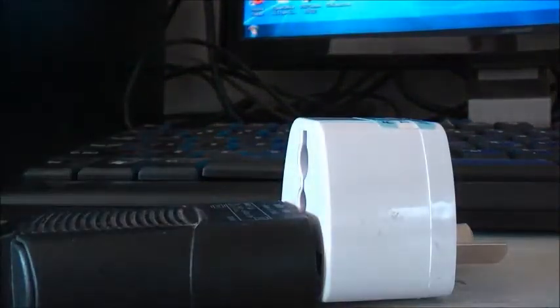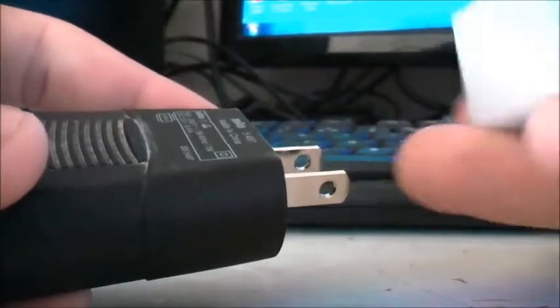If I plug this thing in and get something like a pocket knife and just rest it, it touches a pin - see. I know in America these pins don't have to be sleeved, but when you're using something like that here, it poses a danger. It's not mandatory in America, but since things are made in China and are pretty much universal, they should probably sleeve them anyway for the global standard. At least if someone accidentally puts something between there and they're sleeved, it's safe. Some of these should be sleeved as well.